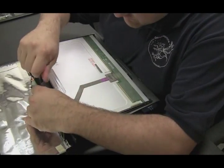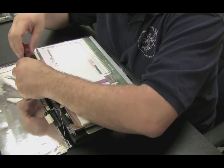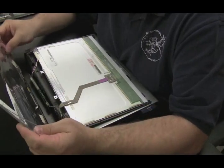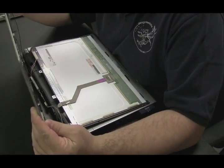We're going to take the inverter off now, and that will allow us to free up the LCD cable and that red and pink cable that actually powers the bulb. We want to remove the whole back cover from the process here, and we're able to get it off now — at least release it from the inverter. Now we're going to pull off the wireless antenna.